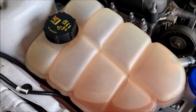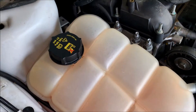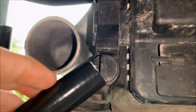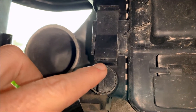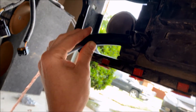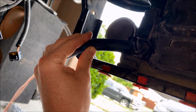Next you'll want to drain your coolant. Come up top first and open this cap — it'll help it drain a little bit easier. Use a drain pan and hook a rubber hose to this little nipple, turn it, and drain into your drain pan. Just note: you will need a pair of pliers when you turn this thing — halfway nothing will come out, you do have to use pliers to turn it the rest of the way.